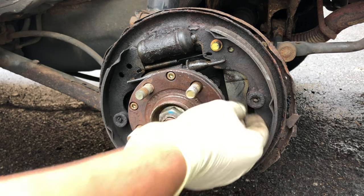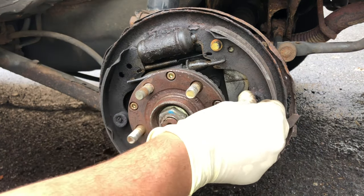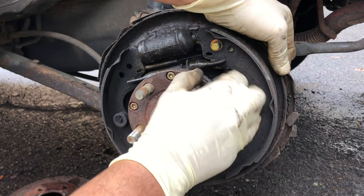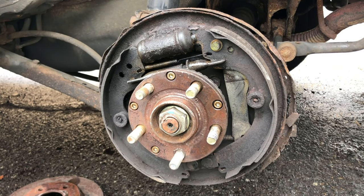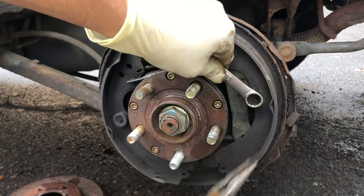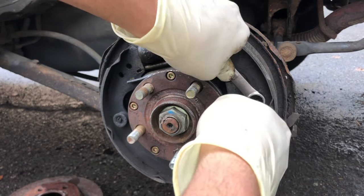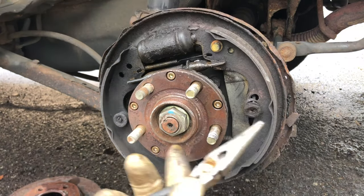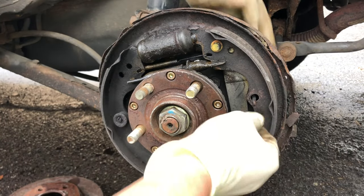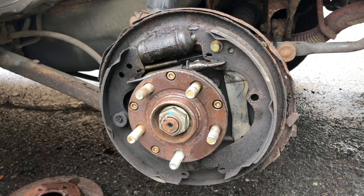And then we have to take off what holds down the shoes. It's spring loaded and it has a pin that locks on the plate here on top of the spring. There is a tool for it that I'll link in the description. It's a cheap tool too, but I just feel comfortable doing it with a wrench, like a 15 millimeter wrench or whatever fits, and a small needle nose. You just hold the pin first, push on it, spin it, that's it guys. This gives a lot of people some problems, but here you go, very easy. Same thing here on the other side.